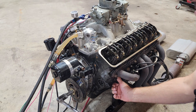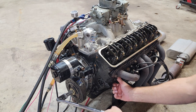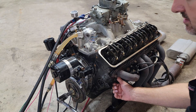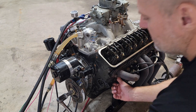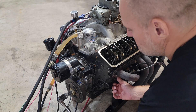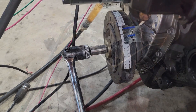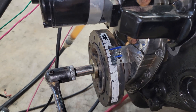I feel suction on my finger so the piston must be going down. We're in the exhaust cycle right now, so we've got a little ways to go. Sometimes you have to rotate these engines over twice before you get to the compression cycle. The exhaust is coming up, intake is going down, so we will be on the compression stroke after the intake closes. Starting to feel compression.